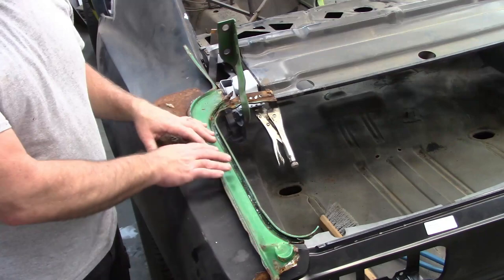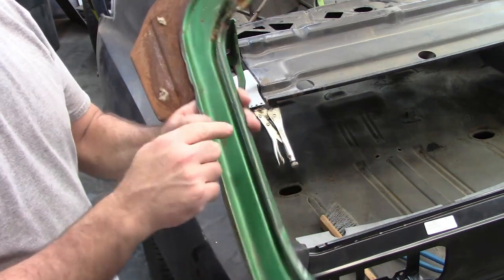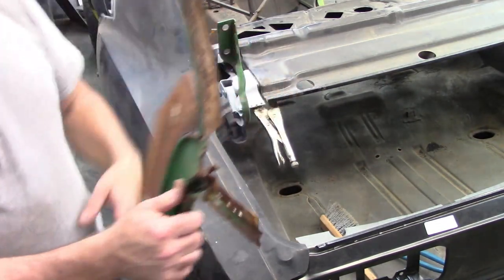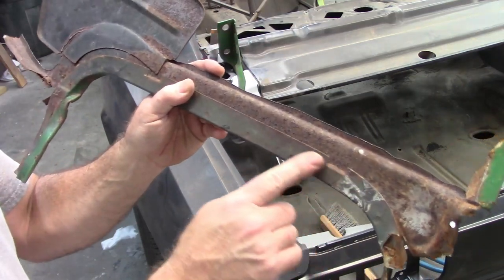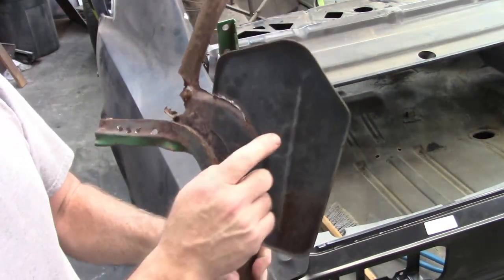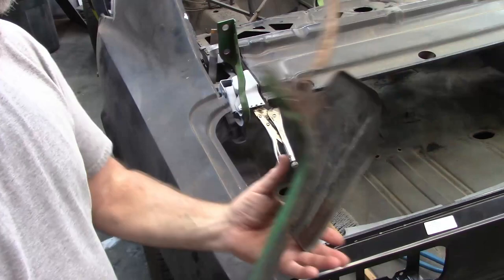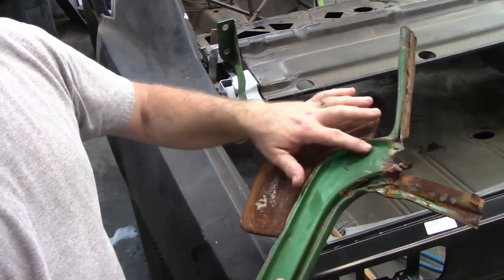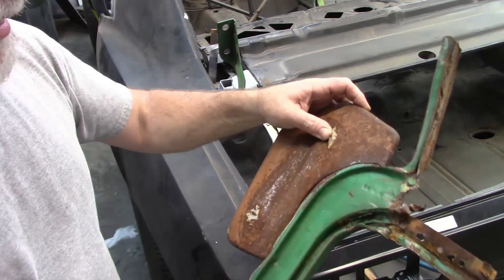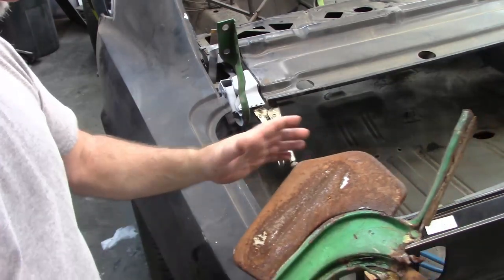What I have here is what's left of the old quarter panel. It has the rain gutter that comes up and then makes a turn. This long leg is what goes underneath the corner. If I turn this over, you can see there's a flange here and how that piece is made. There's also another piece — it's spot welded to what would be the corner of the quarter panel, but up here it just had a foamy adhesive material that you can break loose. It doesn't weld to anything else; it's just there.